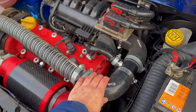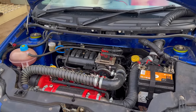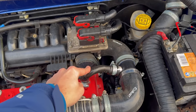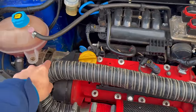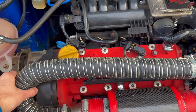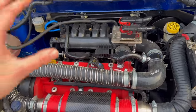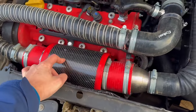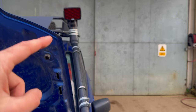All of this is my homemade snorkel — you can't get a snorkel kit for these cars, not yet anyway. Basically it's 51mm pipe coming out of the throttle body to a T-piece so the breather can attach onto it, then another right-angle 51mm pipe — this is going to be changed with a silicone flexi pipe which I have but hasn't turned up yet. I was also struggling with a lot of intake noise on the 1.2 litre engine, so I fitted an additional air filter which definitely helped with noise but is also useful to help stop water getting in when driving in the rain.